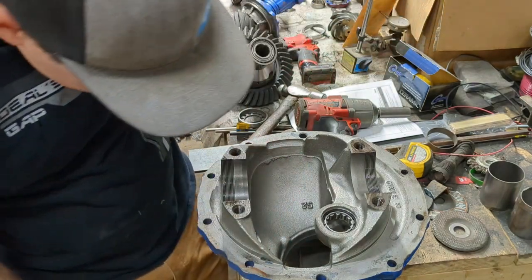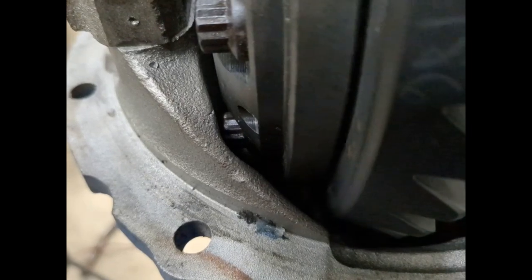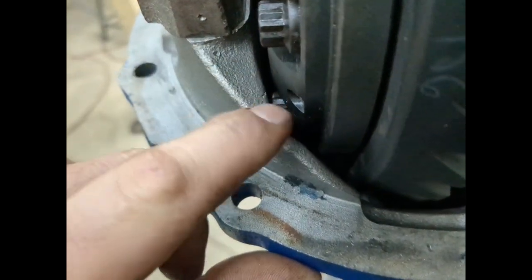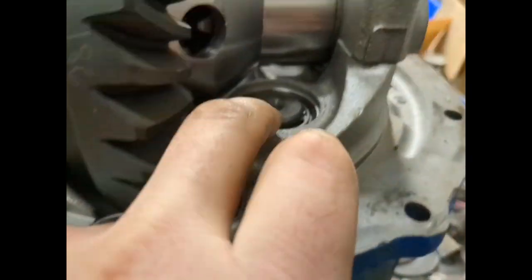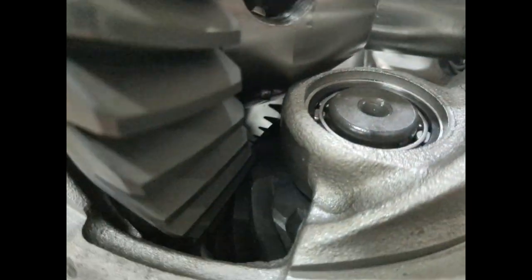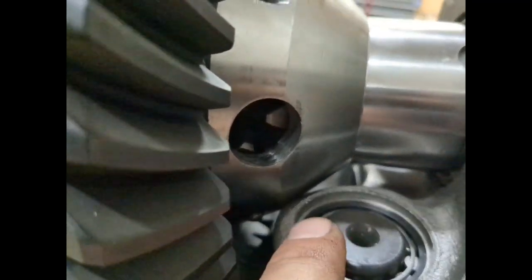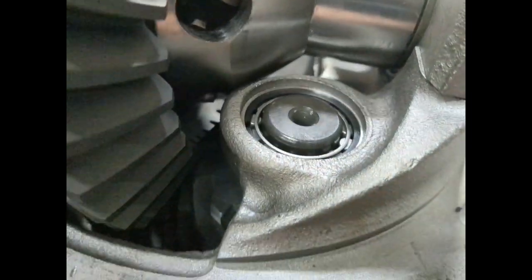With the low light it's pretty difficult to see, but it appears that the ring gear bolts are not going to be our issue. I went ahead and slapped our pinion support in — even though I know the preload's not correct yet — and it's definitely hitting here. So I think what I'm going to do is take everything back apart, get the flap wheel out, and start trying to clearance the case there a little bit.